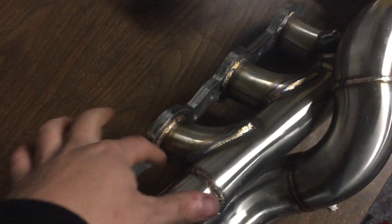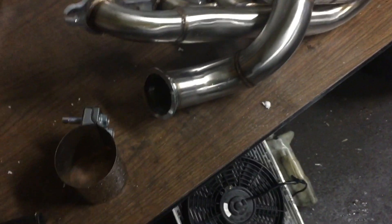There's also a bunch of couplers and miscellaneous stuff. I picked up the two-bar MAP sensor for the truck intake — On3 is the cheapest place to get them, only about 30 bucks versus 100 through the dealer — it goes in the intake manifold and reads boost. I also got the custom plug wire kit. Honestly I was expecting a little better quality for 75 bucks. You need different plug wires because the stock ones will burn up in the runners since they're so close together. They give you a really long plug wire which I don't agree with, but we'll make them work.